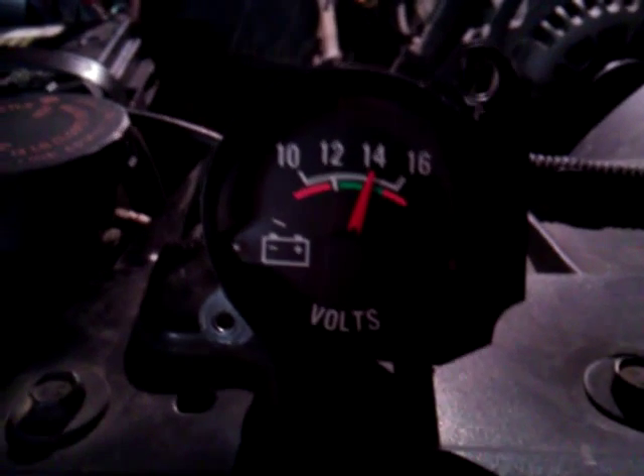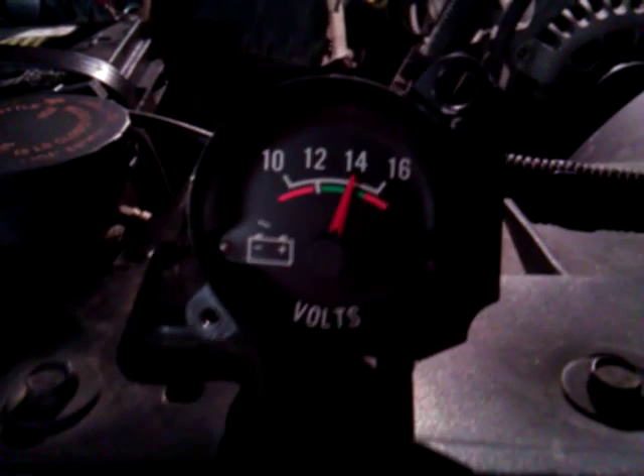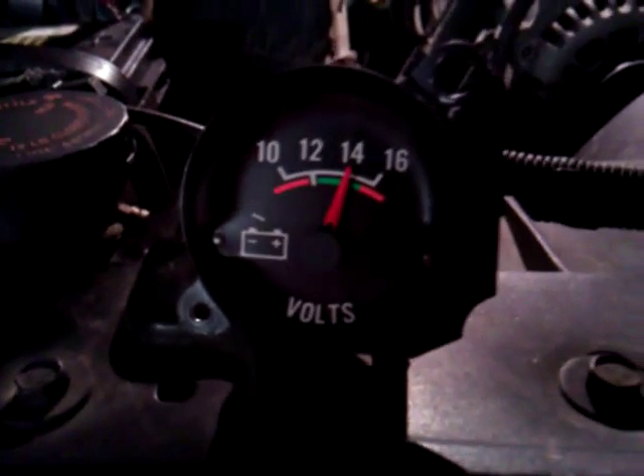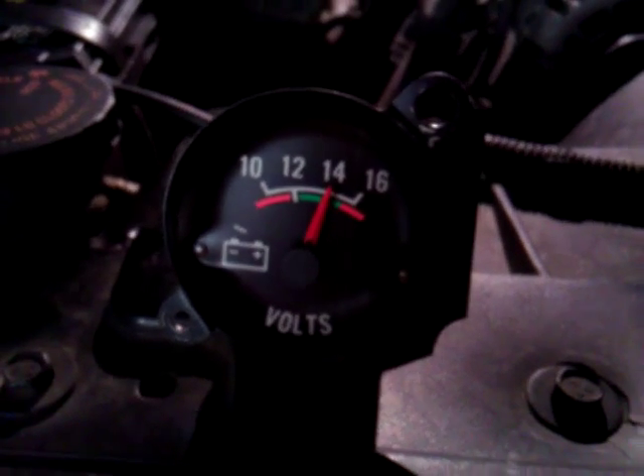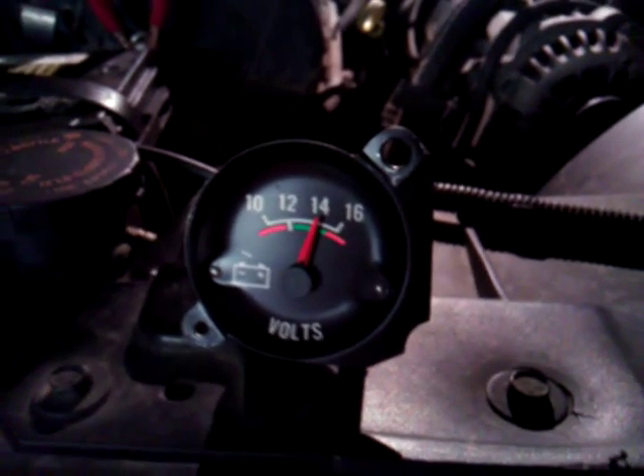There you go. That's what I was hoping for, you know, in the bus there — what kind of voltage it's getting. That's 14 volts. I knew damn well that the gauge was supposed to read that. And this is proof right here that the damn gauge works. So this truck, like I said, the battery's kind of low — that's probably why it's putting out that much voltage. Because that's connected to the battery, so this right here is what the battery is getting. That's what my alternator in the Chevrolet pickup here is putting out. This is a 12-volt truck. Everything in here is 12-volt. That's a 5.7-liter V8 right there. So it's hooked up to this gauge once again, and it works. That's amazing. I knew damn well it worked. I knew I wasn't going crazy. So let's try our toggle switch right here.